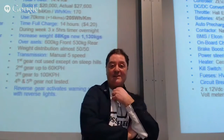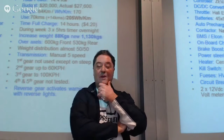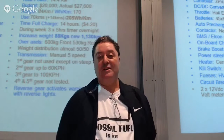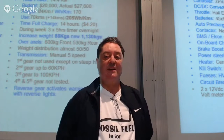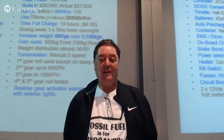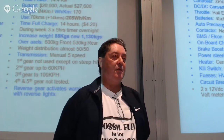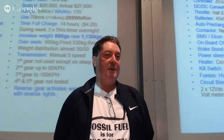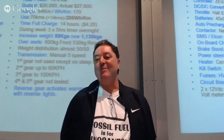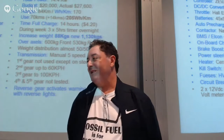Specifications and parts used, in summary. Our platform is 144 volts DC. The budget, as I mentioned, was 20,000. We ended up spending 27,600. Range 84 kilometres. Wasn't bad. We calculated 85, and the reason I know it was 84 is because we stopped 1 kilometre from home. So yeah, tow truck later. So we now base it on 70. Based on 70, you're looking at 205 watt-hours per kilometre.